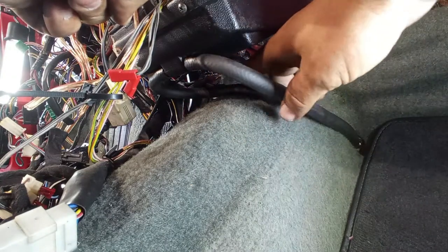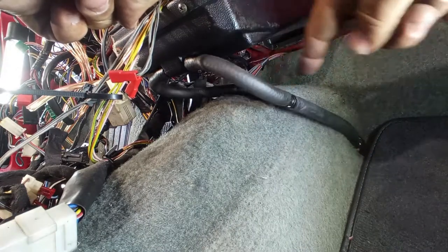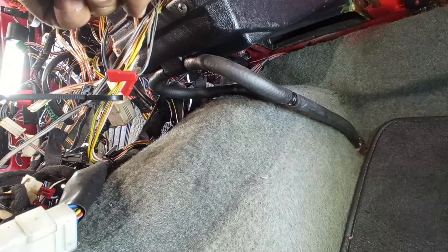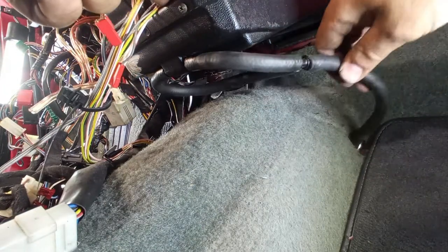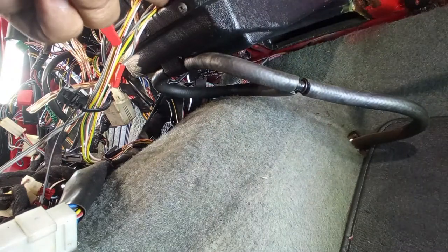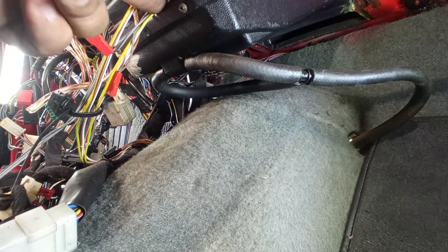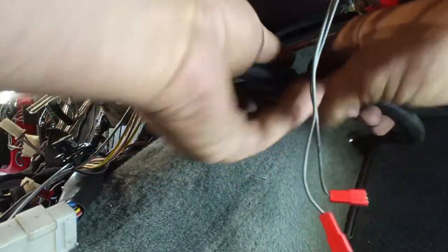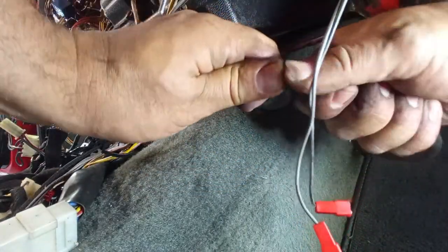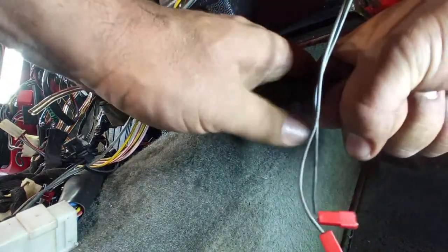Here you have it. This is my repair for the draining. I have one drain over there that goes around in loops over here. Another one like this. I put in this case a T accessory, but from factory it is a Y shape one, and goes out to the outside of the car. I can remove the hose like this, or I can take it out from there. I can choose to do one of two, or I can remove them from here, whatever I want to do. Okay, but it is necessary and crucial to have it. Tight, don't want to break. Do not want to break the accessory, but being so new, I don't think it will.